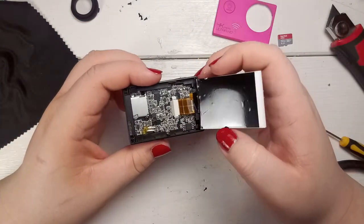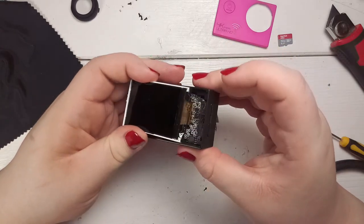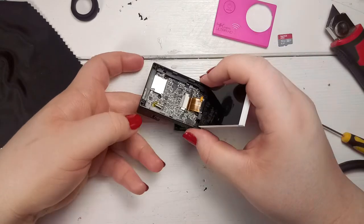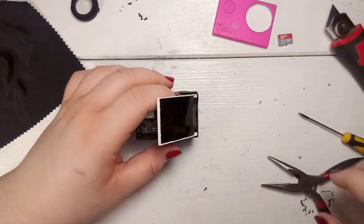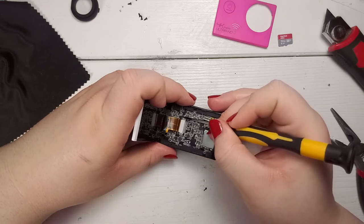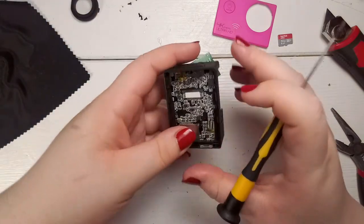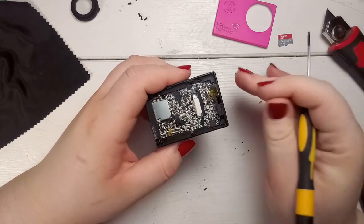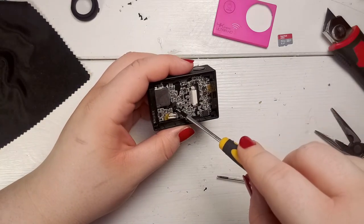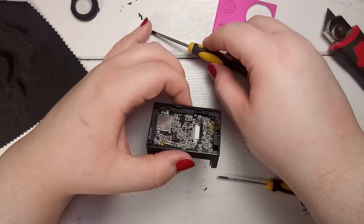After the screen protector is removed, carefully flip the screen, again making sure not to rip the flat cable. To remove the screen, use a small screwdriver and gently push the small black plastic part in the direction of the cable. Now the cable is released and you can set the screen carefully aside — this does not require a lot of strength; make sure the part is all the way out on each side. Now remove all the screws you have access to, except for the ones holding the lens in place — in this case they are located above and below the silver SD card holder.